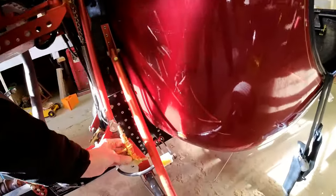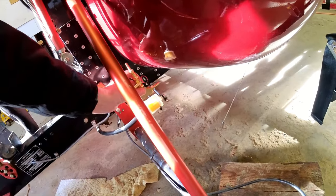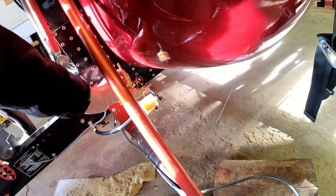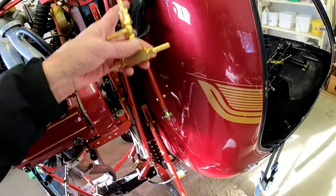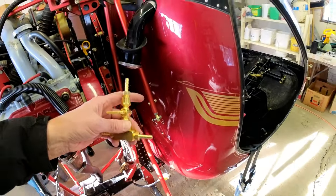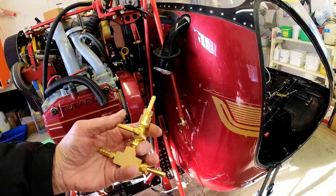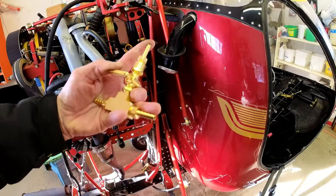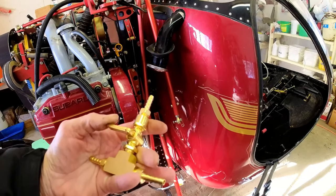Down where that filter is, I'll move that filter over to here, and then a clear hose will come up from here and we'll use that as a sight gauge — put one gallon in at a time and mark it on the plastic tubing. And there's a valve on it so you can close it off, because apparently if you get low on fuel it'll start sucking air down that pipe and starve you for gas.